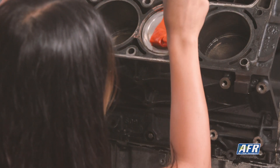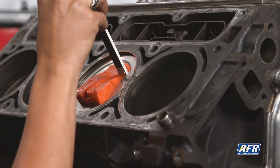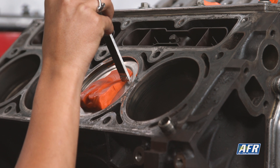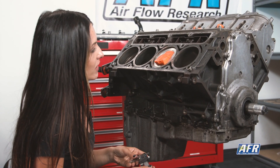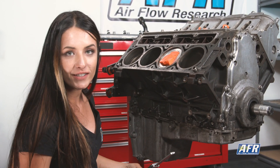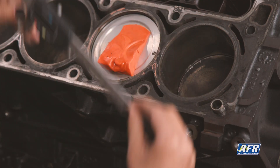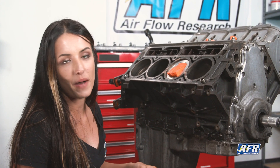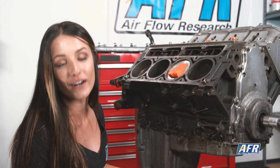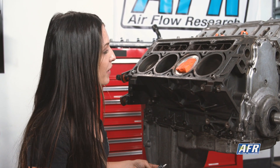Here you can see there is a very thin part of the clay, but that is not where the valve is actually indenting into the clay. Here is our indentation, and we're going to be looking for the thinnest area to check our clearance. We're checking the exhaust side first — slowly closing the calipers and pressing onto the clay. We're working with a hundred and twenty-one thousandths clearance on the exhaust side, which gets us in our tolerable range. On the intake side we're also working with approximately a hundred and twenty-one thousandths clearance, which is much more than our needed clearance of eighty thousandths. So I'd say we're good.